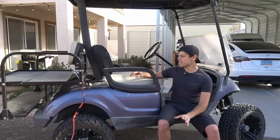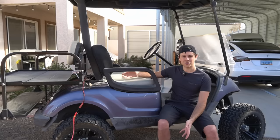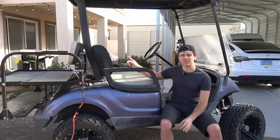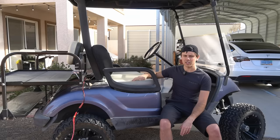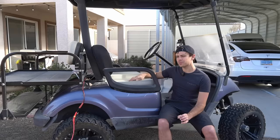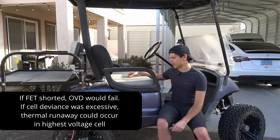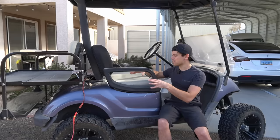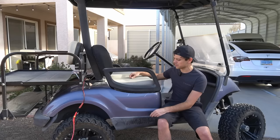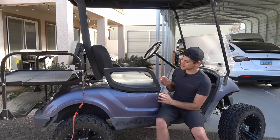I use marine grade heat shrink for everything else since this is 90 volts DC, which could technically kill me. Last night I drove this up the mountain next to my house and didn't have a single hiccup. Usually when a battery doesn't work in the golf cart, it cuts off on the first hill, so I don't think this is going to have any issues. This is a pretty high quality battery — especially compared to scary older packs where a shorted FET with cobalt-based chemistry charging off solar could catch on fire. With this, I don't have to worry — it's lithium iron phosphate with a high quality contactor-based BMS. Pretty darn good battery, and I think it's going to last a very long time.